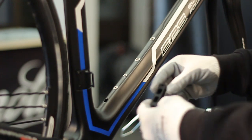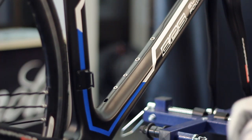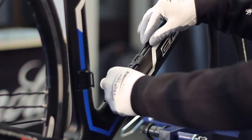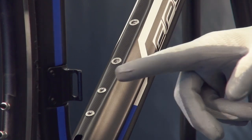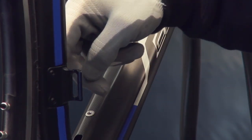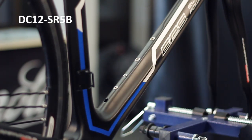The position of the power system must be established prior to ordering to allow for the selection of the proper mounting bracket to be used to fasten it to the frame. Also make sure that you have ordered the front derailleur clamp attachment if necessary, which for 35mm frame diameters has the new Campagnolo code of DC12-SR5B.